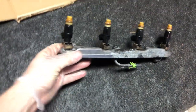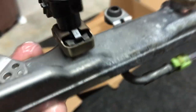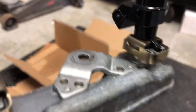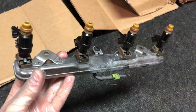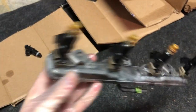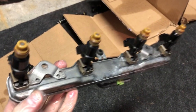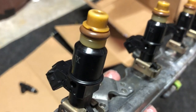We have all four fuel injectors back installed with the metal clips back in. Make sure your setup looks correct — the metal grommets go in between the clips so it's nice and secure. Now we're going to do everything in reverse order and reinstall this back into the car. Put the mounting bolts through those two holes, put the nuts back in, and also make sure you coat the O-rings on that end with engine oil as well — you only need a very small amount.